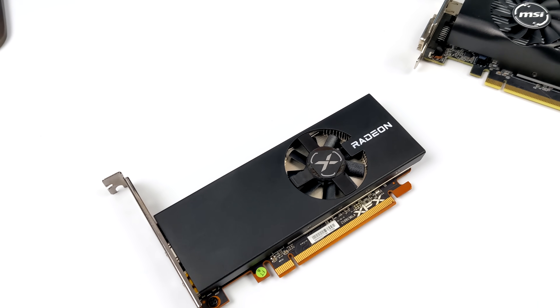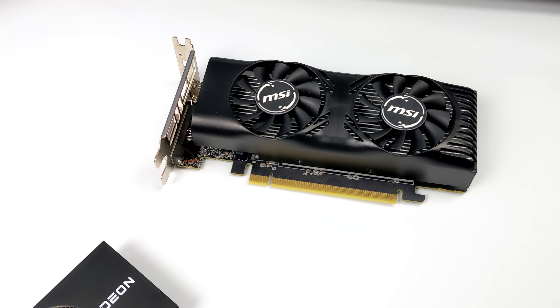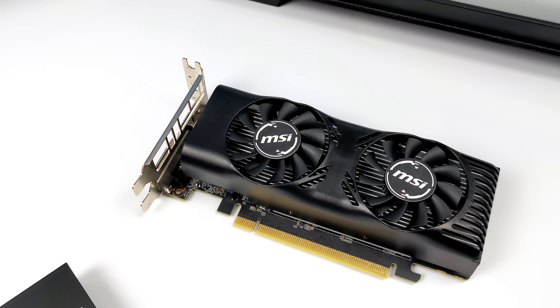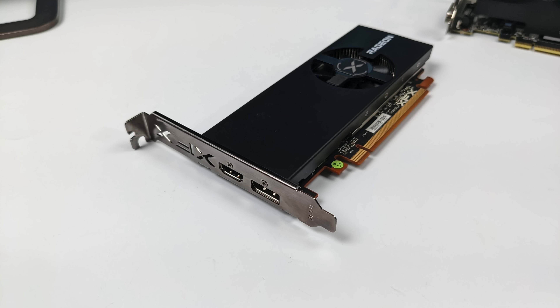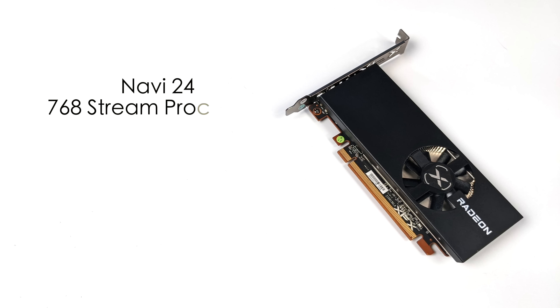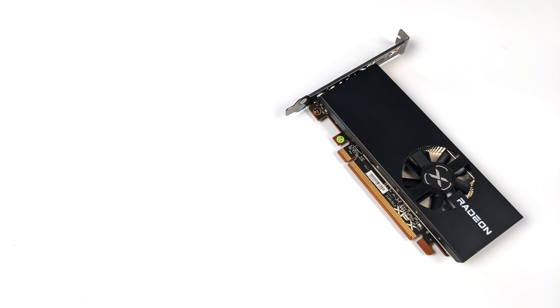This variant of the 6400 I have here is low profile and single slot. In the past, when it comes to building a small form factor emulation PC, I always recommended the GTX 1650. But the low profile versions of the 1650 have been really expensive, and with the RX 6400 you can pick this up for around $150 right now. We've got two video outputs — full-size HDMI and full-size DisplayPort. It's got an actively cooled heatsink, and it's based on Navi 24, so we've got an RDNA 2 GPU here: 768 stream processors, 12 compute units, 4 gigabytes of GDDR6. It only pulls around 53 watts, so we don't need any extra power at all. It's got a maximum boost frequency up to 2321 megahertz and it utilizes PCIe 4.0.